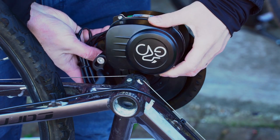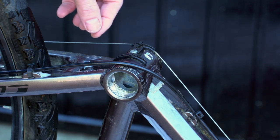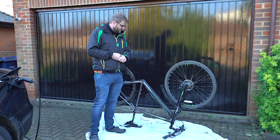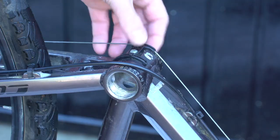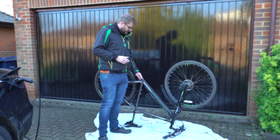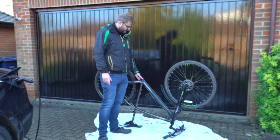It was all going so well — I was just about to put the motor on and then we hit a snag. When I tried to slide the motor on, I found a plastic gear cable guide underneath whose profile is just a bit too high. I asked the community, and a couple of suggestions came back: the main one was to replace the unsheathed gear cable with cable housing all the way from the selector to the derailleur. Another suggestion was to cut a small piece of gear housing and attach it to the bottom bracket to run the cable through at a lower profile.